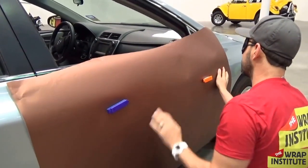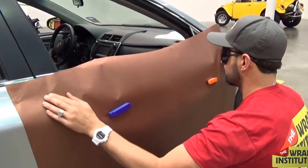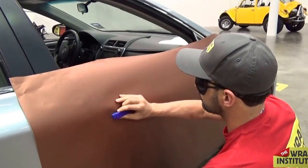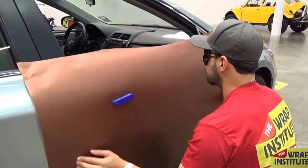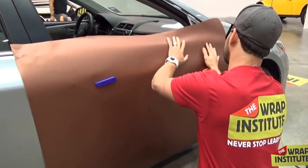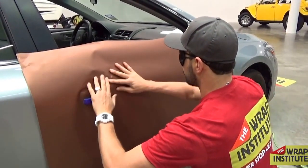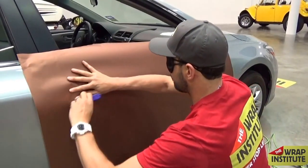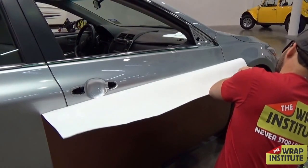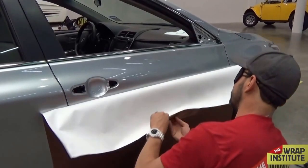What I want to show is that with the right material, good technique, and right tools, you can wrap this door with your eyes closed. I've set my magnets on and I'm making sure I have enough bleed on all sides — really taking my time, making sure the magnets are in the right place. Obviously can't see; I put it right in the door handle, so I take it out, put it on the flat surface, double checking all around. Once I feel I have enough bleed left to right, top to bottom, about two or three inches, I remove the backing paper.